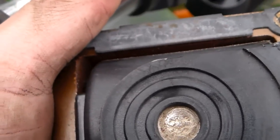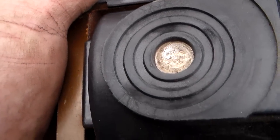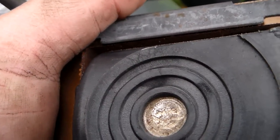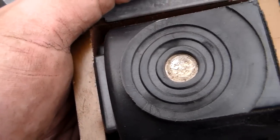If you look here kind of closely — I wiped some of it off to see how heavy it was — you can see right there and out here that thing has been arcing out the side. It's done enough that it's actually created little carbon tracks on there. You can see it looks kind of like a little spiderweb pattern on that.